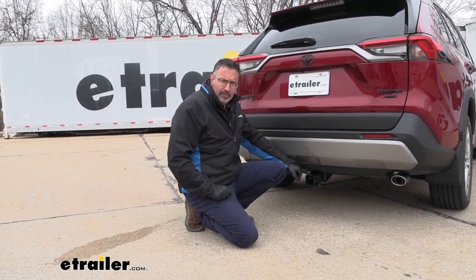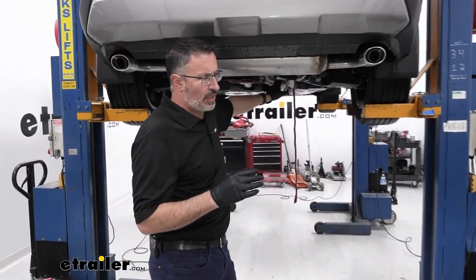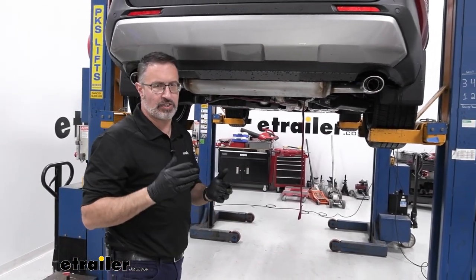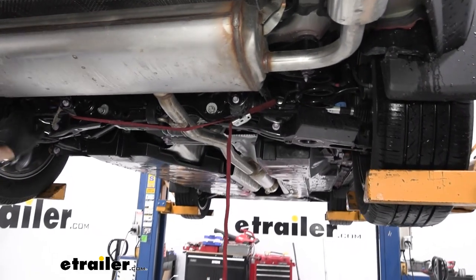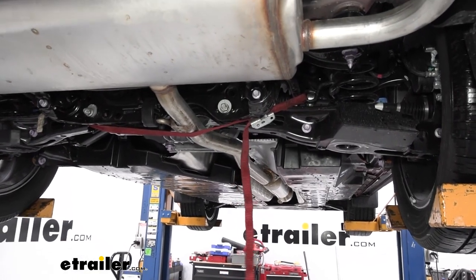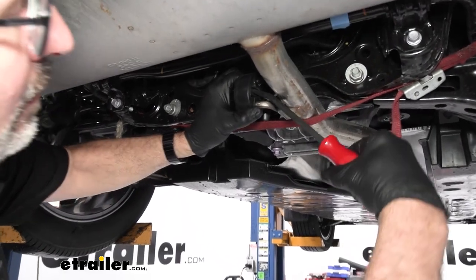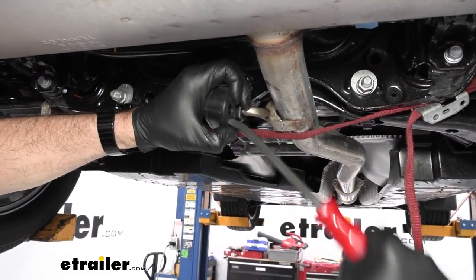Let's get this install started. First thing we're going to do — it's not stated in the instruction manual, but when we were trying to test fit this hitch earlier, it was just kind of tight to get it in between the exhaust tips, and we don't want to scratch stuff up. This exhaust is really easy to lower down, and that's what we're going to do right now. I've got a cam buckle tie-down strap hung from the coil springs on either side, and that's going to help us control the exhaust as we lower it. I've got a pry bar here — I'm going to loosen this exhaust right here first. You can just take a pry bar, go in, give it a twist and push. If you've got some silicone spray, that'll help it come off easy too.